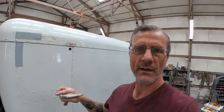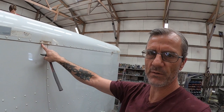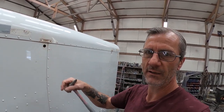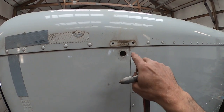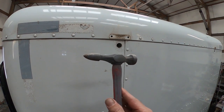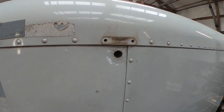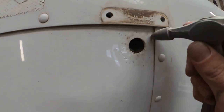Here's one of the two in the back of the sleeper, and there's the other one. There were work lights right here and, as you can see, I drilled these rivets out — I actually used a die grinder because I couldn't get to them; they were behind the light. I ground them off until they popped out, and then there's the hole left behind. As you can see by the way I'm working the light, this is indented — it's in about an eighth of an inch. The way that happens is with one of these: this is a shrinking hammer. You can also use a welding slag hammer — I used a slag hammer for 20 years. You tap on this with your hammer harder than I am right now. I've already done it — as you can see, I've indented it, pushed it in. You can see all my individual little hammer marks all the way up through the corner here.